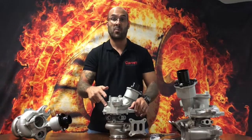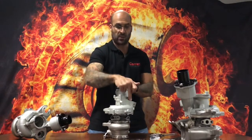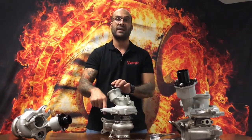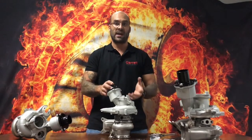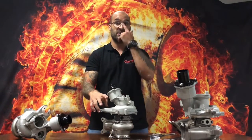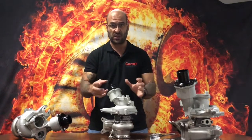It comes with an MLS multi-layer steel gasket for the exhaust inlet, stainless steel turbine housing with revised AR, and revised AR on the compressor housing as well. It's a muffler delete, complete bolt-on package. All you need to do is supply your divertor valve and your axial wastegate — your electronic wastegate or electronic actuator from your existing IS38 — and bolt those on to this turbo.